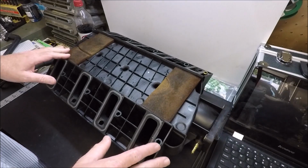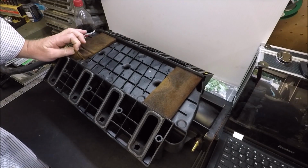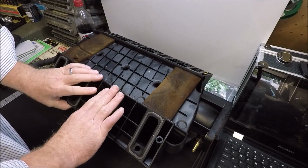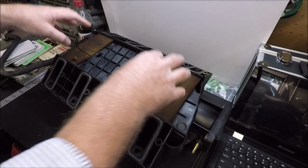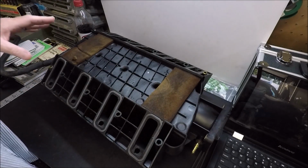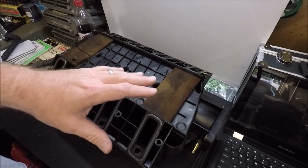And now that I've said buy the new gaskets, that brings me to my second point, which is these foam seals here, which mine are soaked with water right now because I just finished cleaning, okay? When you buy the gasket set from Felpro, it comes with new foam pads. Use them. Use the foam pads, guys. Freaking use them. I'm going to say it one more time. Use them. I can't tell you how many times I've seen people just rip these off and they don't put the new foam pads on. They're here for a reason, guys.